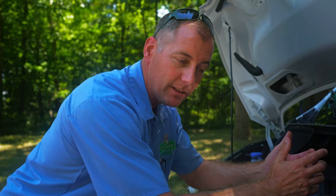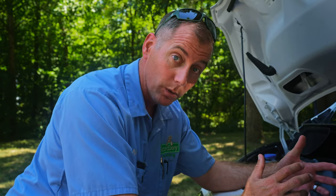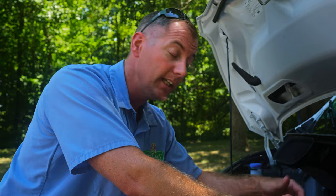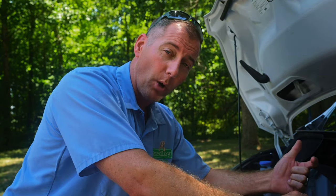You've also got a series of heating elements. A standard gas vehicle gets its cabin heat from hot liquid flowing around the engine. Since we don't have hot liquid flowing around an engine, we have to make our own hot liquid. There is a reservoir of coolant — that coolant will cool the batteries but also heat the batteries — and they've got some heating elements in there that provide our cabin heat.